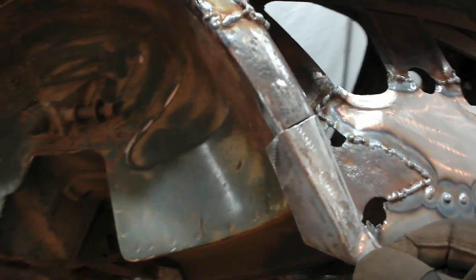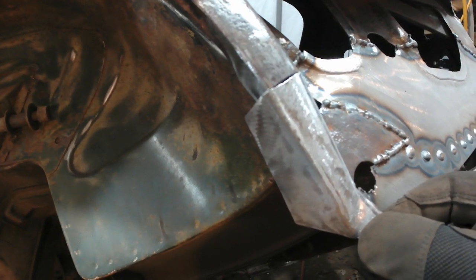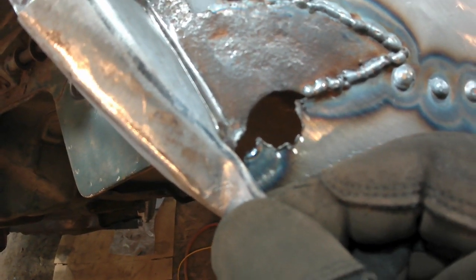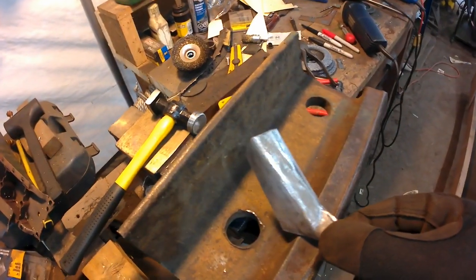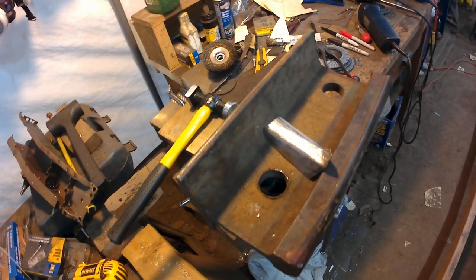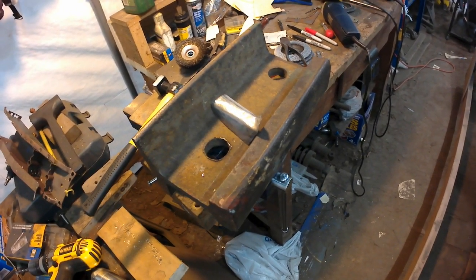I'll have to squeeze that edge in a little bit to get it to line up with the inside lip of the fender well. And then right down here I'm going to have to put in another bit of a squarish patch or something like that. This actually turned out pretty well — all I used was a hammer and the anvil. Just beat a little bit, try it, beat a bit more, try it again. Pretty happy with how it turned out.